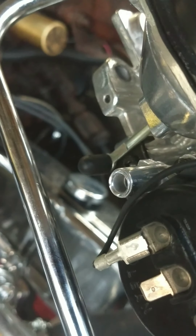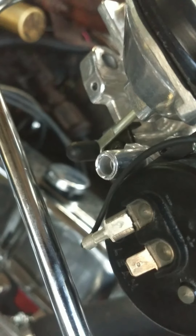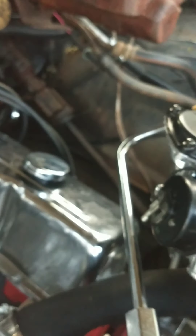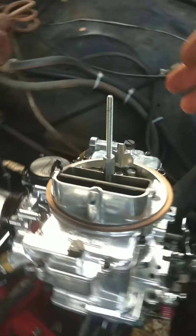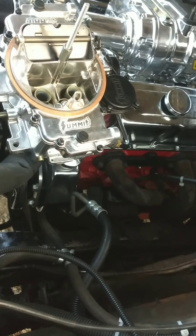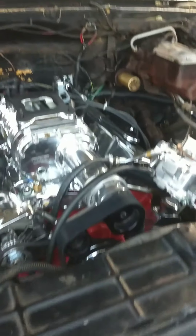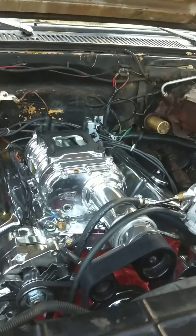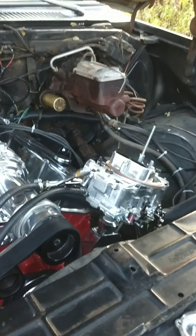But if you look here, see that little rod coming down? It has that little black cap on it. The clip that holds this diaphragm on that rod was gone, so I put that vacuum nipple on it to hold it on — that's all it is, just a little vacuum nipple. Yeah, so the back two barrels weren't even opening. So now when I go down the road and I hit the gas at about 3,000 RPMs, when those secondaries open, it pops — it goes lean.